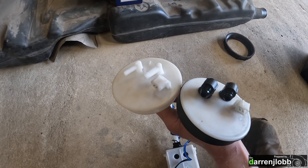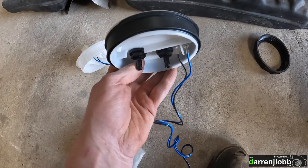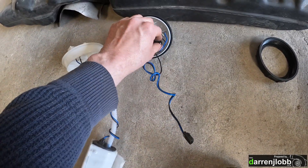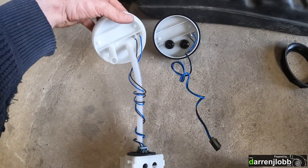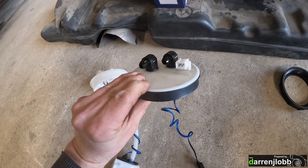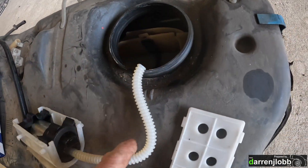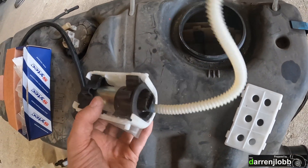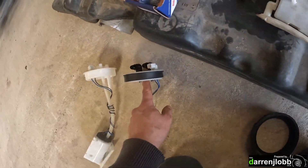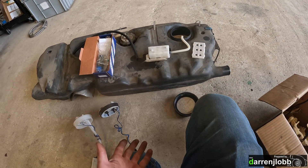On the inside we've got two barbs so we can use a short piece of hose to go down to the fuel pump and also a short piece of hose to the bottom of the tank to help prevent aeration. That bit is done. Now we're going to change the pump - it sits down inside the tank in a bit of a sump or swirl chamber area and it actually pivots so it stays level. We're going to replace that pump, re-hose it up, confirm the height is correct, and then the tank should be tied up.